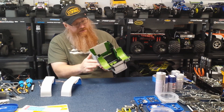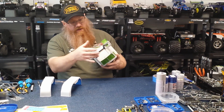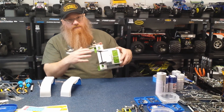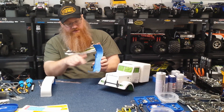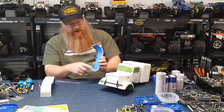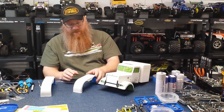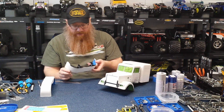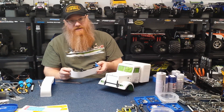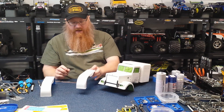For the inner fenders I used cardstock to block off the back and the grill, keeping as much blue and primer out as possible. The fenders were spray-painted black first, then I put tape on the inside. Everything else will be blue — the areas that are too tricky to tape off I'll just paint everything blue and come back and brush-paint those in black.